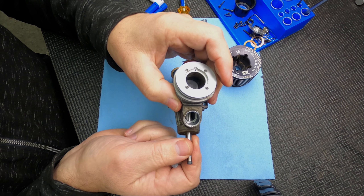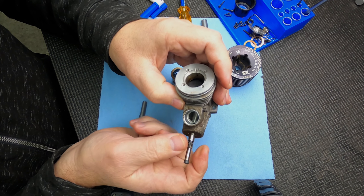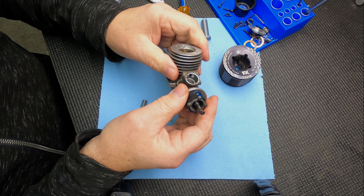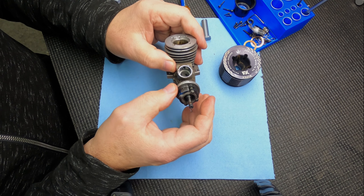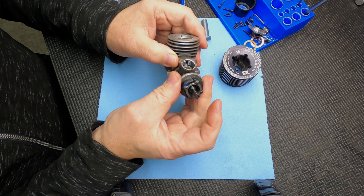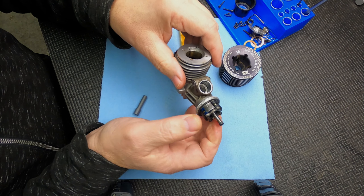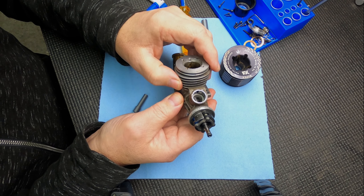This is the other tool — looks pretty simple. I've had a video on how to remove a clutch when it spins on the crank. Normally when I get a clutch on an engine I'll just grab it with big pliers when you take the bell off or the nut off that holds the clutch on. But sometimes when you go to pull the nut off you've got some Loctite on the threads, and all of a sudden the clutch wasn't tight against the taper and it starts spinning. So then you're holding on with the pliers, turning the crank over, and the piston's just going up and down.